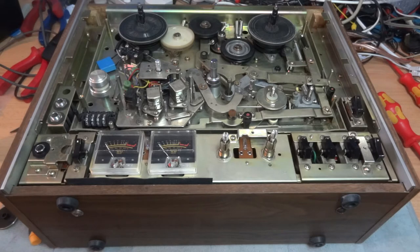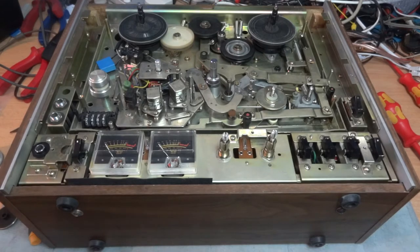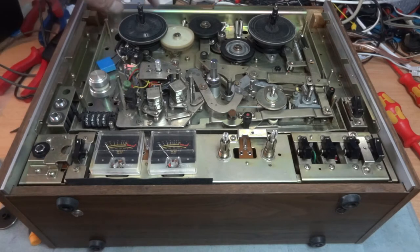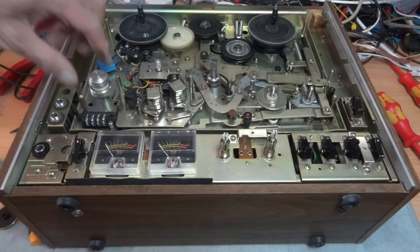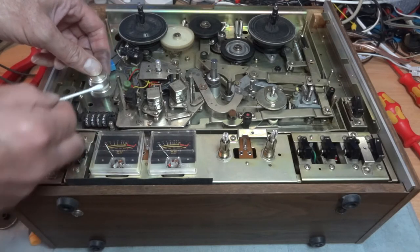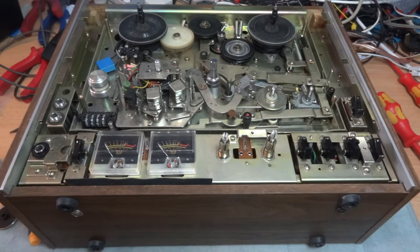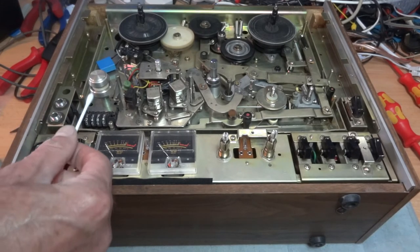With the top off, this part is the cleaning guide for the parts where the tape travels and touches. I use this video cleaner solution - an alcohol-based cleaner suitable for tape heads - applied with a cotton bud or clean cloth. The tape comes from the spool past this very first guide, which is a piece of plastic that spins as the tape passes through. Get your cotton bud in that gap and clean it as well as possible.